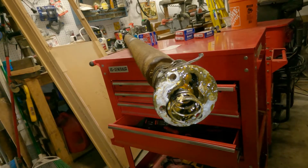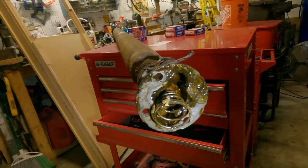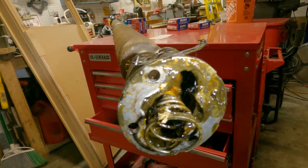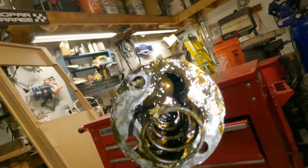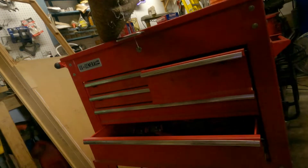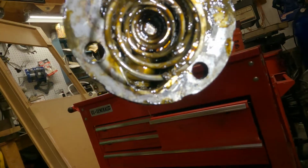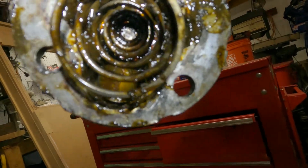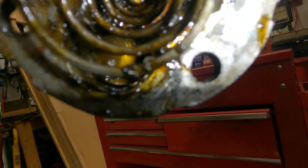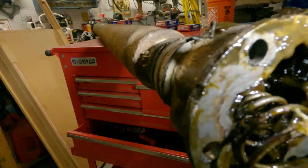She's out. This is the rear - this one's got a spring. Of course the Savoy, or Thelma, has got a regular U-joint in the bag. There's the balls in the trunnion. This thing is well lubed. I don't know what that smells like - it actually smells different. There's a cap - you see the cap on the end of the ball on the bottom side - that comes out, and it can be a real giant pain in the butt.